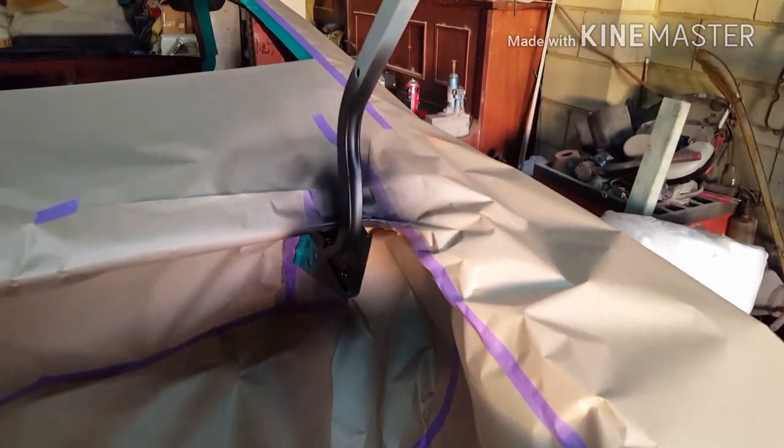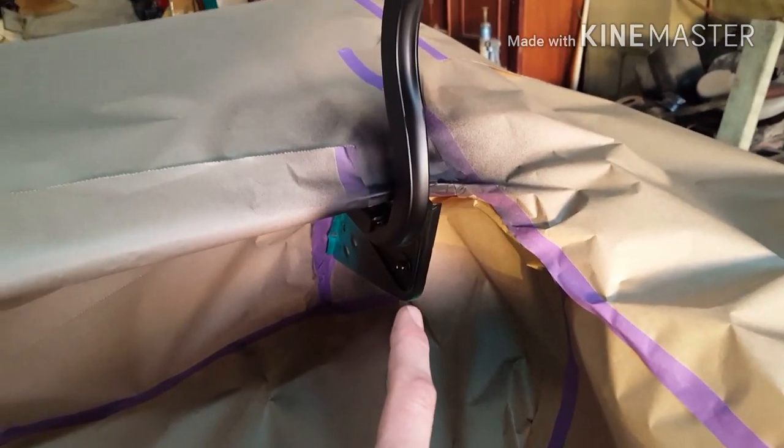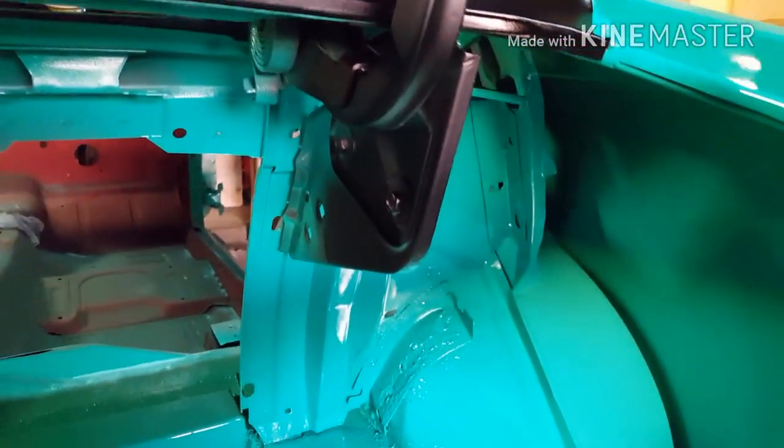So this is another thing just unique to the 1970 Boss 302s. It was the black under the trunk, and also it was on the trunk hinges. Now, when these were painted in the factory, the black overspray just went everywhere. It was just a mess. So this here is a happy medium. The hinge was body color to start with, and then I just masked off all the remainder of the trunk and just put the black overspray down there, like so. Yes, so now if I mask this, you can see what I mean a bit better. We've protected all this area here, but it still has the original look up on the hinge without the mess.